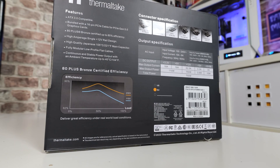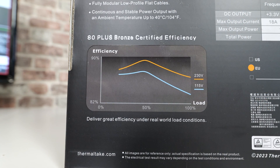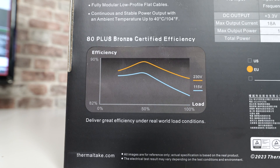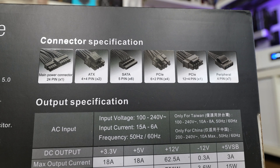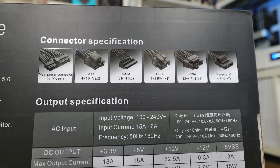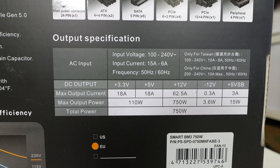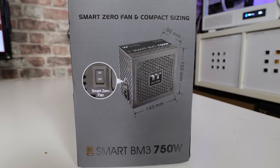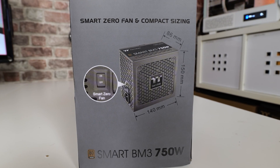On the back of the box, it goes over some of the key features. It also talks about the power efficiency — you're looking at somewhere around 85% efficiency, depending on your region. Obviously US at 110 volts does get slightly less than we do here in the UK, where we benefit from our 230-volt power feed. It also gives you a layout of cables and tells you what to expect inside. It's got the output specifications — Thermaltake have done what I feel is the right way to go. They could have marketed this as an 850W power supply, because you do have 110 watts on the 3.3 and 5-volt rails, whereas on the 12-volt rail you have a dedicated rail which will deliver up to 62.5 amps, giving you that 750-watt rating. In terms of dimensions: 86 millimeters in height, 150 millimeters width, and 140 in depth, so you should be able to fit this in relatively modest enclosures.